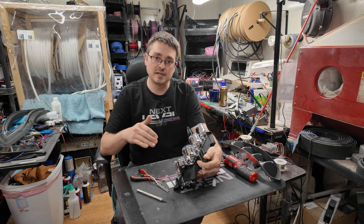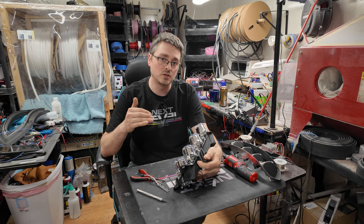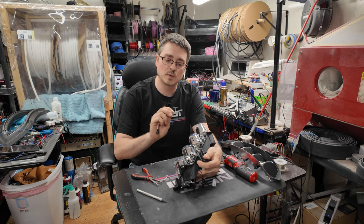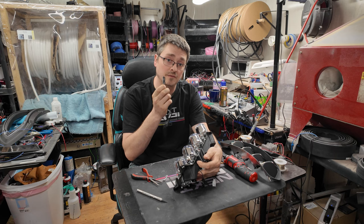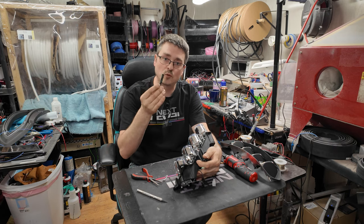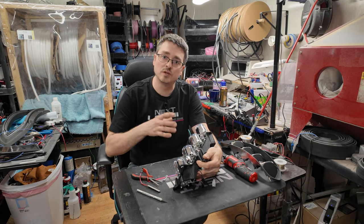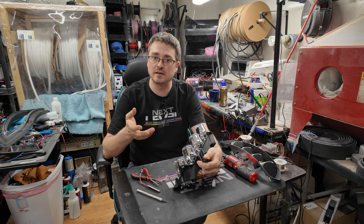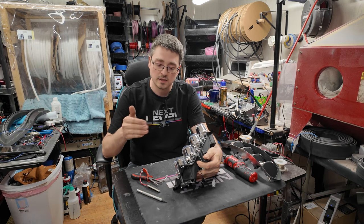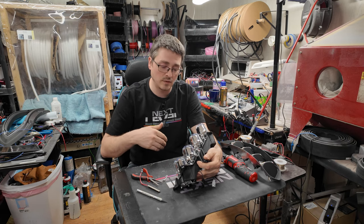And that means that every LED does the same thing, whereas with addressable, you can control each LED individually via that little smart chip. And in the case of the UCS, the smart chip is actually on the back of the PCB, and one of the reasons we use rigid PCBs for our thinner stuff. And when it comes to things that need to be more flexible, we do have the wider strips for things like the infinity mirrors, where that PCB is still on there, or the chip is still on the PCB, but it's just moved to the face of the PCB for that purpose.